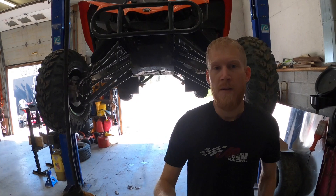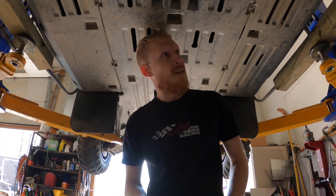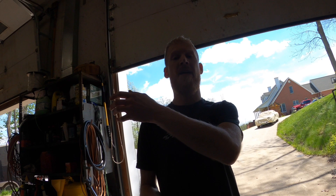Anyway, it's on the lift. We're going to pull the skid plates down the center off and drain the oil and see what comes out of it. Then get the rear diff taken loose to slide it back far enough to disengage the driveshaft out of the transmission. I also got to undo the torque tube basically from the engine flywheel to the transmission. Then once you unhook everything else, you should be able to slide that transmission, turn it, and slide it up out of the passenger side. But I don't know how that's going to go, being that we've got door bars welded in there. On your normal stock unit you can undo the door, open it up and slide it out that way. I might need an extra set of hands at some point, but we'll see when we get there — that's future me's problem.